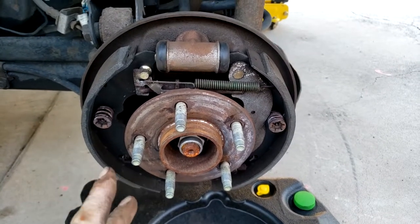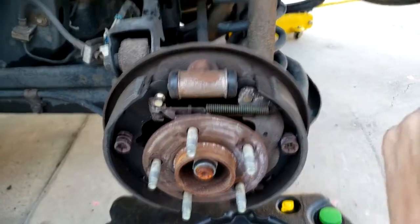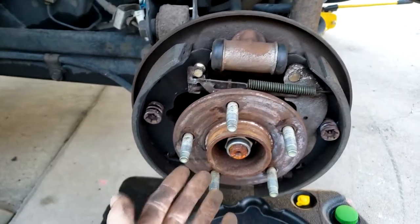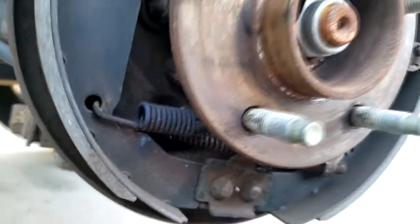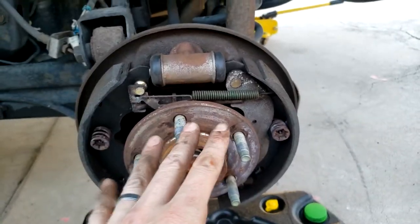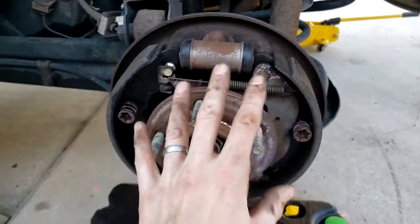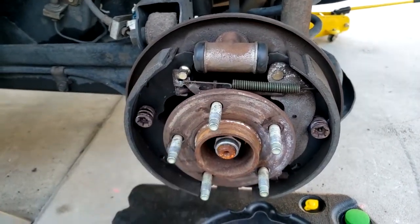Before I go, I want to share a quick tip. When replacing these brake shoes and you have it all apart, take the other side off as a reference — remove the wheel and drum but leave all the components there. When replacing all these springs and components it's really hard to keep track of where everything goes. Work on one side at a time and go look at the other side of the car to use it as a reference. That's why it's good to put jack stands on both sides so both wheels are up and you can check each side as you're working.